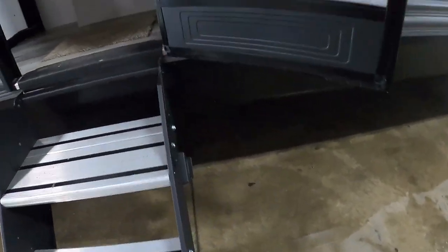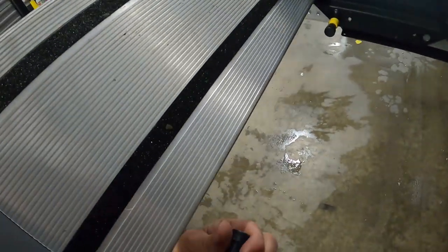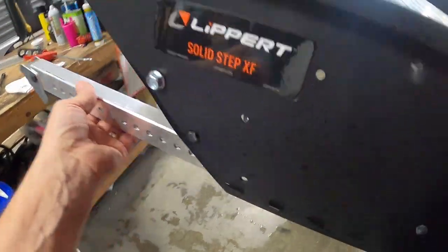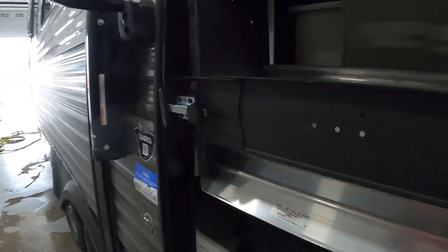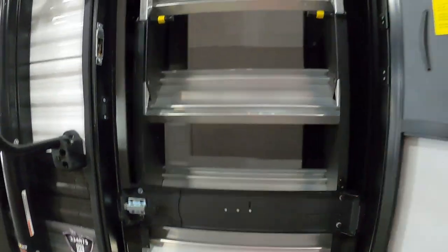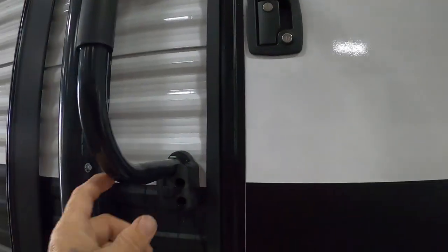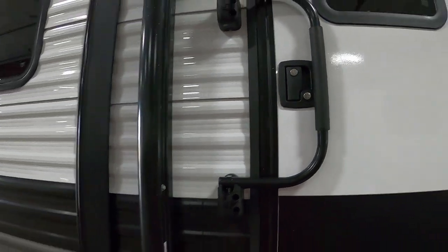Shut off your lights and exit the unit. The biggest thing on these steps, whether bringing them up or down, is to make sure your exterior door is all the way open — otherwise the step will catch on it. Your step feet are adjustable: remove the cotter pin, move it where you want it, and set it up inside — that'll lock it in. Lock the deadbolt, lift and turn the handle — that's how you want it for traveling.